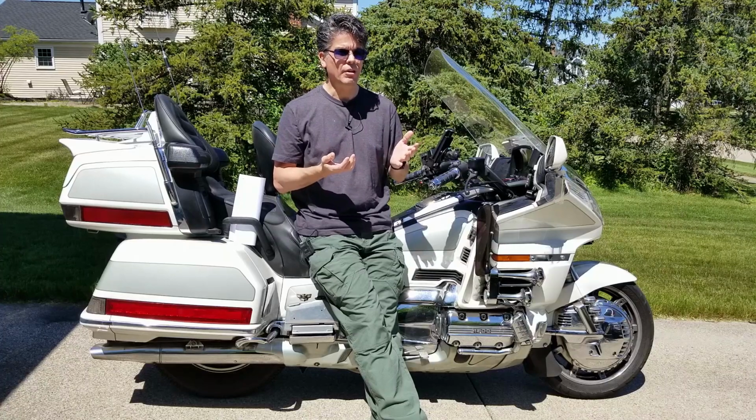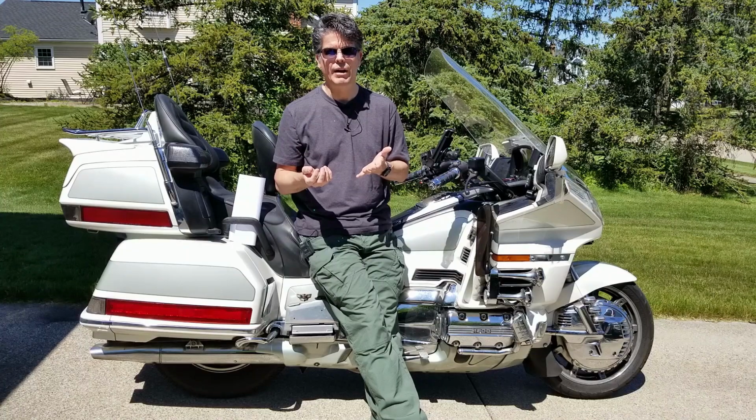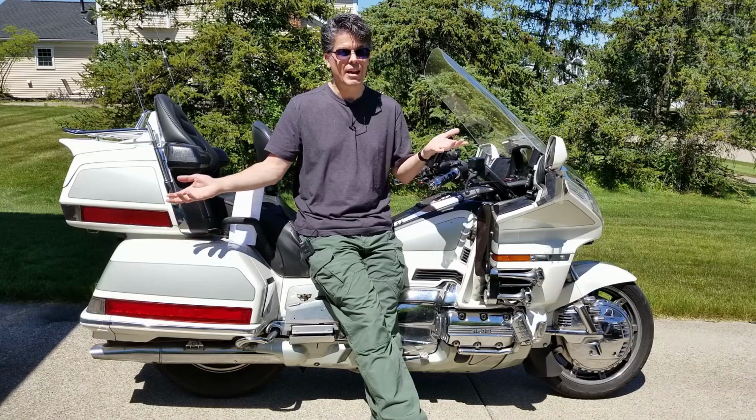It's not going to last forever. You're probably going to have to redo this kind of thing every 2 to 3 years, depending how much you ride. But for a $5 tube of JB Weld compared to the cost of a new set of air shocks, it might be worth trying.